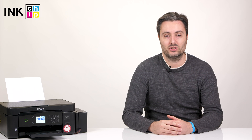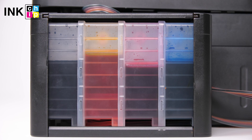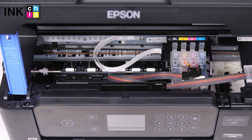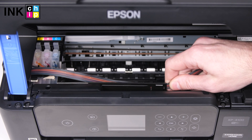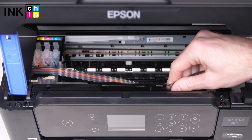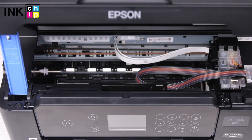Reattach the rear unit. However, sometimes the printer displays the paper jam error whereas there are no paper issues. It's a common error for printers with the continuous ink supply system. You need to check the ink tube and fix it properly to prevent blocking of the ink cartridge holder. Move the ink cartridge holder to the other right position and adjust the tube length.